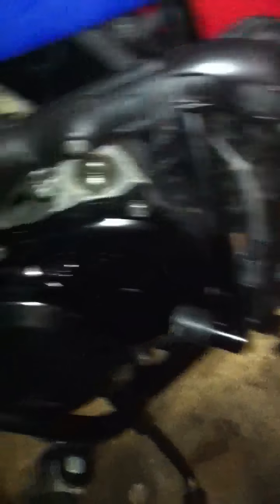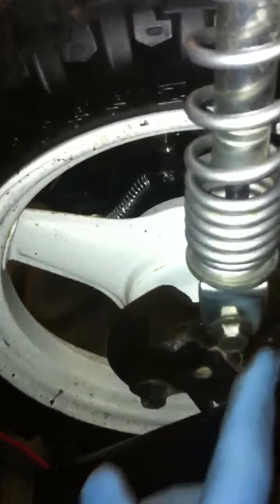You just have to loosen them up so you can slide the exhaust off — makes it easier to take the whole exhaust off at once. Under the main muffler there's a 12mm bolt, which I've already taken out, and a 10mm holding the rear muffler on.